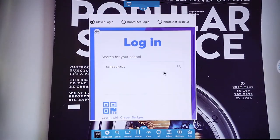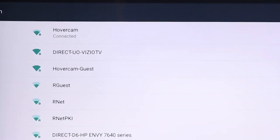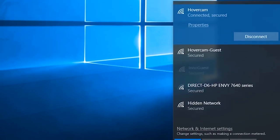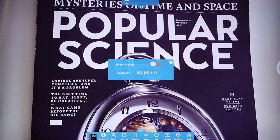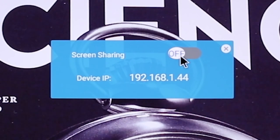The Nilo 100 features DashTop2 app, an application that allows users to remotely view, annotate, and control the Nilo 100's document camera from a mobile device or internet browser. To get started, first make sure both the Nilo 100 and the screen sharing device are on the same wireless network. Next, select the screen sharing option from the settings tab located on the control dock. Once the screen sharing menu comes up, use the slider to turn on screen sharing and take note of the device IP.